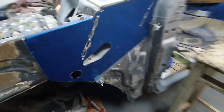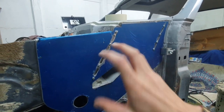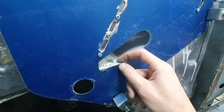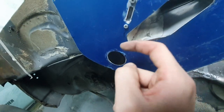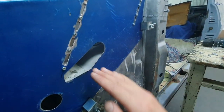Time to start prepping it for actually closing up. I have everything mocked up in place but there's still some work to do. This is the repair piece — I've screwed the new panel to these two edges so everything is really nice, tight, and super strong. Everything lines up pretty good. I need to make this gap up here a little bigger and line up these edges for a butt weld, and file everything tight for a nice smooth transition.